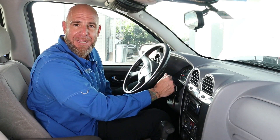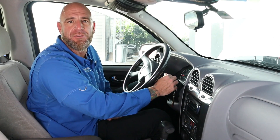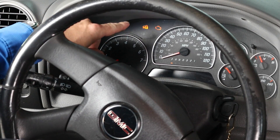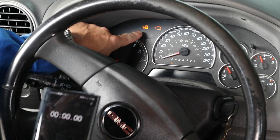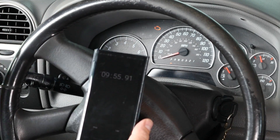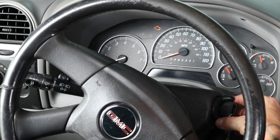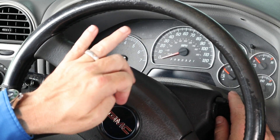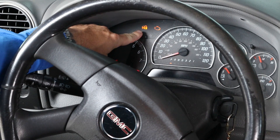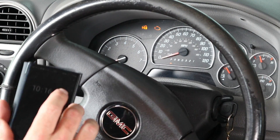PK3 Plus is going to require you to engage all the way to the ignition — you're going to pretend to start the vehicle. Some vehicles will crank at this point, some will not. Insert the key into the ignition and turn the key to the start/run position. Attempt to start the vehicle, then release. Notice the cluster and look for your security light. Set a timer for 10 minutes. Once the clock approaches 10 minutes, wait for the security light to turn off. Once the light is gone, turn off the ignition for five seconds. After five seconds, turn the key to the start/run position again. Attempt to start and look for the security light. Set your timer for 10 minutes. This is round two.